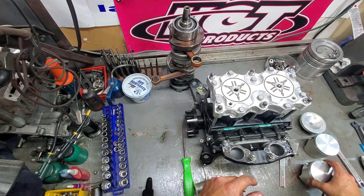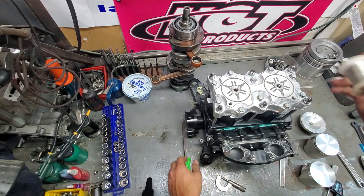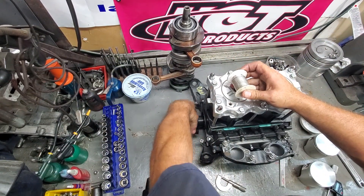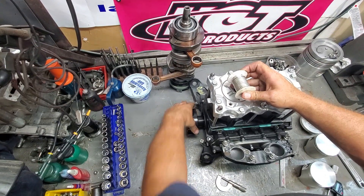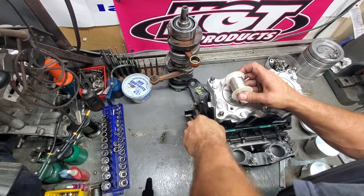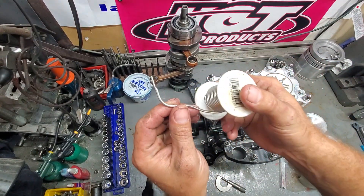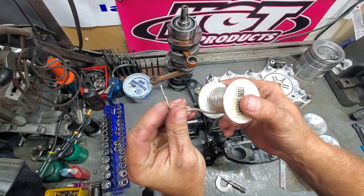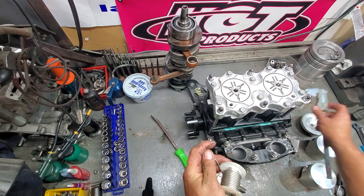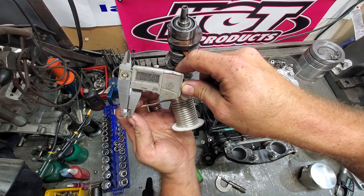Let's get started. We'll check this out and see how close we ended up getting. We'll go in and rotate it to top dead center. Take a pry bar, kick it over. Now if you can see, I flattened that area, so now we're going to measure that area.